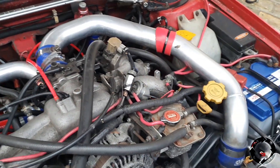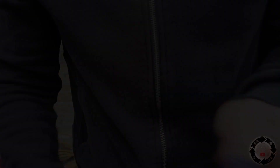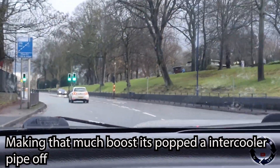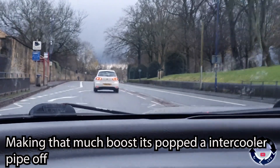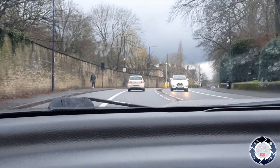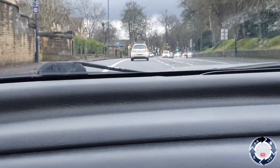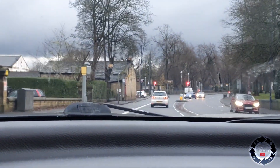We've got two sets of pipes here - I think this size will be it. Where does it go though? It goes under and onto the dump valve. There's no point chopping it, it's only a bit extra. Yeah, that's on there. We keep this in the car just in case. But it sounds like we've got another issue - we can hear some boost leaking. We've got some boost leaking somewhere, so we're going to have a quick look and then retest.